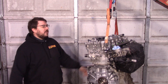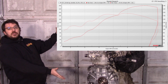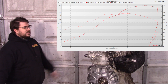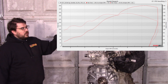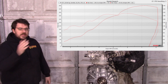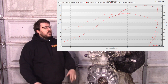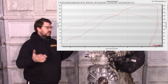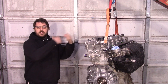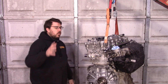This is just better all around, and that dyno plot — that lovely 240 wheel horsepower dyno plot — it worked. I'm going to 8200 RPM; it should be safe to 8500 or 8600, and that's still with a margin. That's not like 8650 is when the whole thing flies apart, but the power was obviously going downhill at that point, so I didn't see a whole lot of point in continuing past that. So 8200 it was.